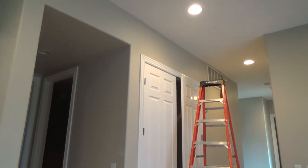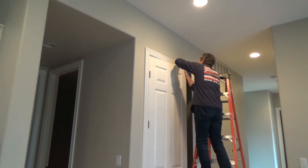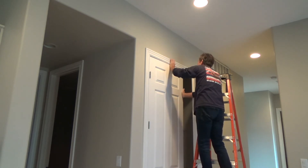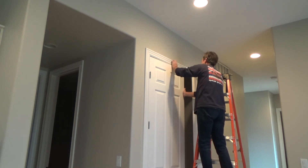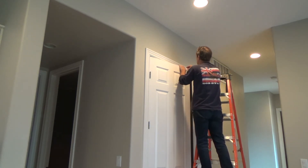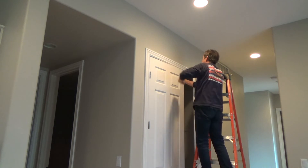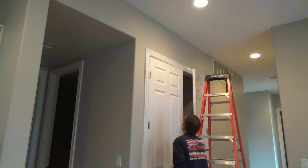One door down, one to go up here. I'm going to loosen it just a hair more — you just don't want it to hit. If the top of your ball is rusty, you can sand on it, spray some WD-40 on it, and have it spring up and down a little bit. You can also spray a little bit on your strike plate, and that'll help too.